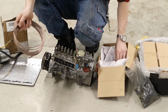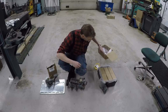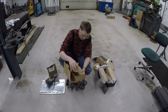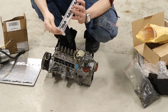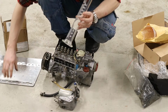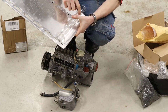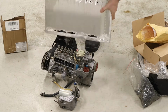Pipes to go between that and that one, and nuts. We gotta measure the amount of fuel. To do that, this is old style measuring stuff, but I got these test tubes, 6 of these ones. I'm going to run it with the original fuel here. And I got this one made up. So I'm going to use probably an O-ring or something to lock this one here and get the injectors on top behind it like this. Some way to tilt it in.